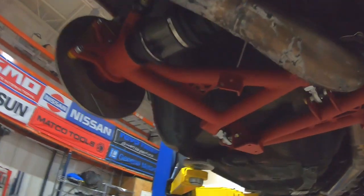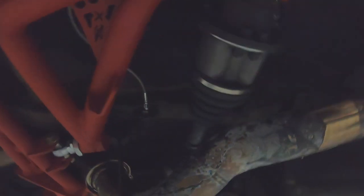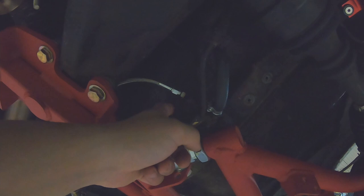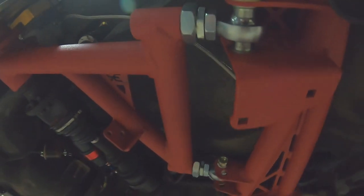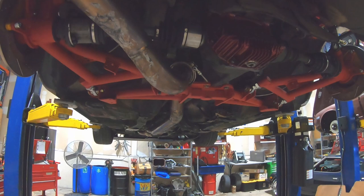We got the brake hoses temporarily run — just enough to have it not pissing fluid all over the floor. There's a female-to-male adapter that goes in on this side and then goes all the way to your caliper. On this side, it's a male-to-male adapter into this little distribution block that splits the rear line out of the master cylinder to go to both left and right wheels. We'll clean up the routing and get it secured in a bit. At least it's hydraulically sealed and we can flush or bleed it. Let's move on to the parking brake cables now.